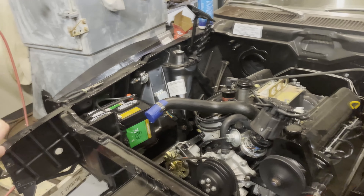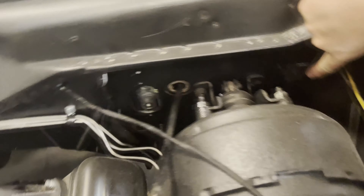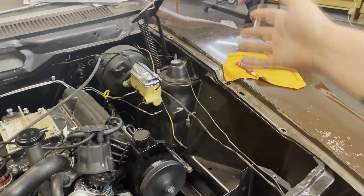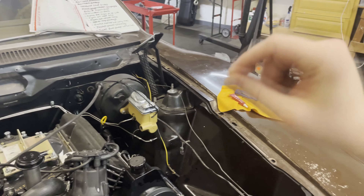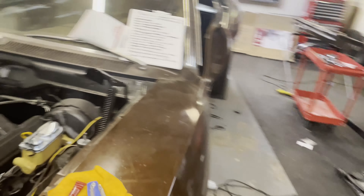I'm going to try to maybe get a little bit of the wiring done. There's the actual harness over here — I don't know if you can really see it, it's kind of dark — but there's a lot of connectors in there. I want to try to make sure they're clean. I probably should have done that before I got the brake booster and all that stuff on there. I might take the hood spring off to get to it better. I'd like to poke around in there, maybe use a wire brush of some kind, clean it out. I'll also do the same to the wire harness up in my loft, and the fuse panel that's under the dashboard — just make sure everything's clean.